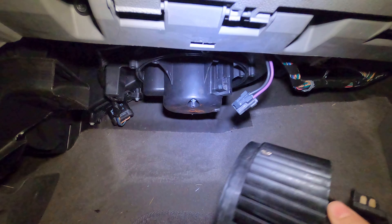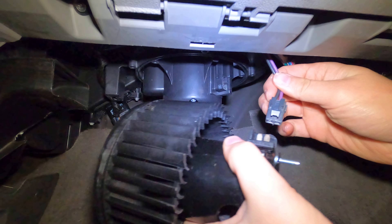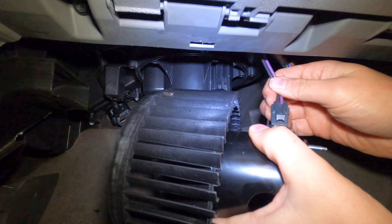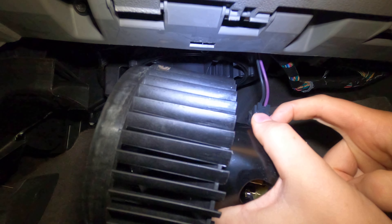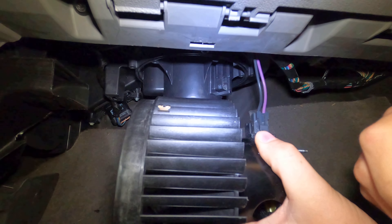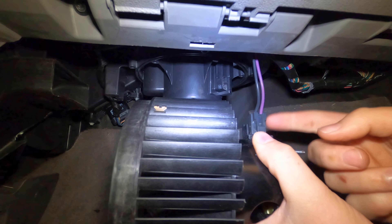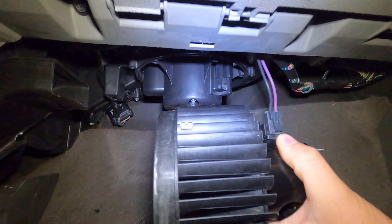Let's try something. What I want to try is just connecting these two. Now, if you don't have a multimeter or whatnot, and you just go in and pull the trigger and order this part, which is the blower motor, and you want to know if it's the resistor or fuse or whatnot — obviously check the fuse first — if you already have this part, just plug in the new one and give it a little life.